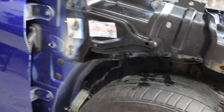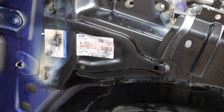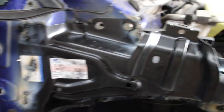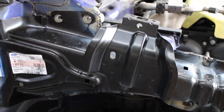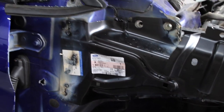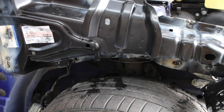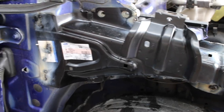That's all done now — all in place, all welded up. Very pleased with that. It's not the neatest of weld, I admit — for all you welders out there looking at this in horror, this is not the neatest. But it is firmly in place and it's not going anywhere. It's also lining up perfectly. I did a test fit of the wing before I welded anything up — I had all the clamps in place and test fitted it to make sure it was fine, and I've done it again since and it lined up okay.